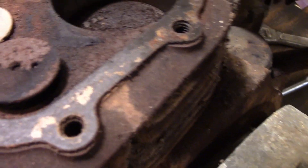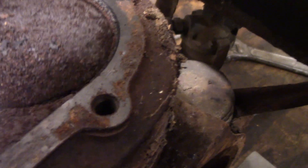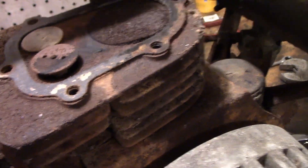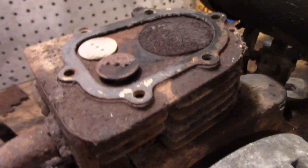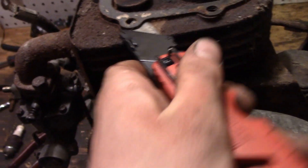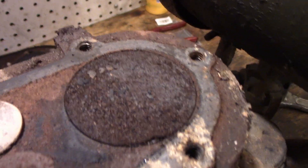Actually not awful under the head. We've got a stuck intake valve, and I bet that exhaust valve is stuck too - it's coming up and hitting something. Let me get this head gasket out of the way. This looks like an original asbestos gasket. I'm going to get the valves soaking with some Kroil and in the meantime use the wire brush and wire wheel to clean up the piston a little bit. Cleaned it up - I actually freed up the intake valve already. Shot a little Kroil in there, tapped it with the mallet, and it just freed up.